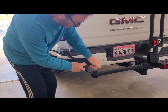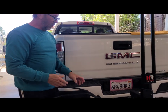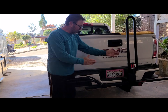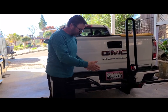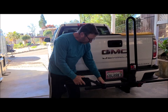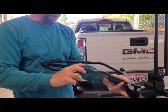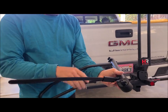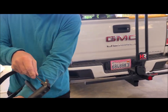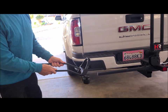Loosen that up to slide the rack on. The racks are offset — one goes here, one goes back — so they're evenly spaced. If you install two on the inside and two on the outside, the outside ones end up farther apart. You want equal distance between all four. Also, the knob installs up; the little piece can turn, so pull it and wiggle it around and rotate it until it locks in. That's how it should look.